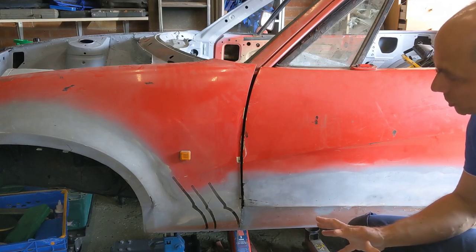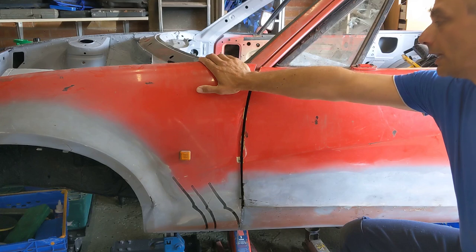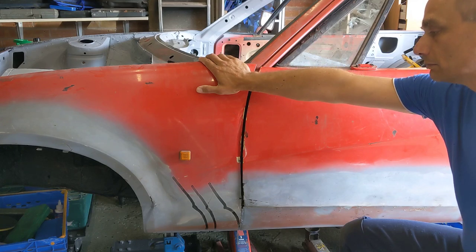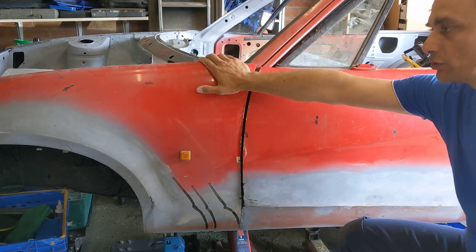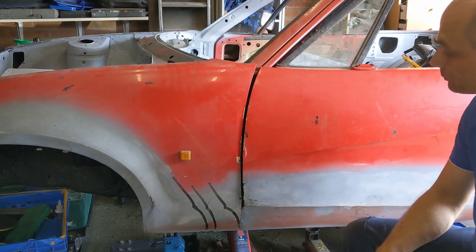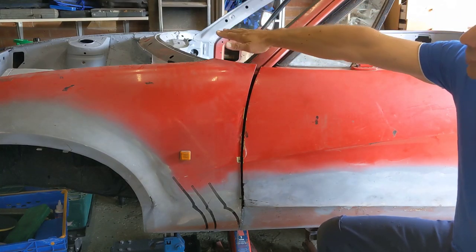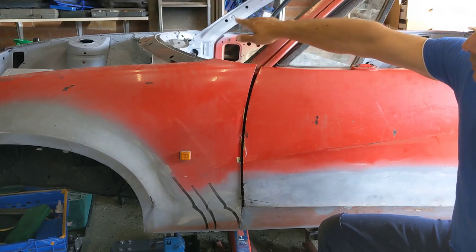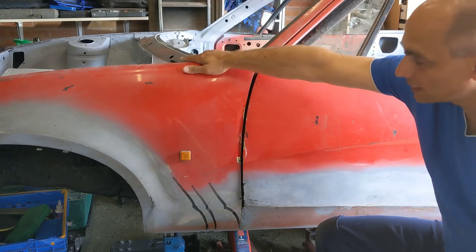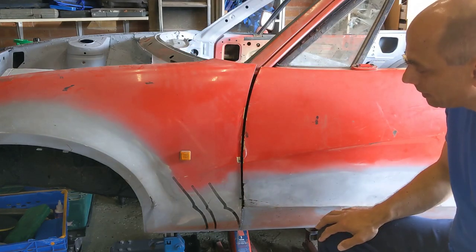So plan of action: I think this fender is going to have to come off, but I don't want to do that until I actually know what's wrong or have some theory as to what's wrong. The thing I'd forgotten is that when I laid the bonnet on top, it had a good fit on the right-hand side and quite a large gap on this side - that indicates that maybe this fender isn't in as much as it should be.